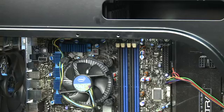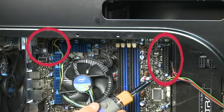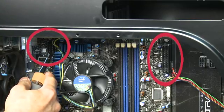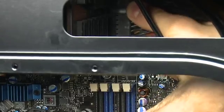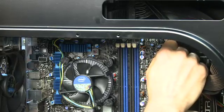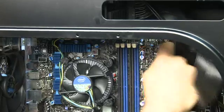On the motherboard you'll typically see two power connectors: the larger one generally away from the CPU, and then another one a lot closer to the CPU that's a bit shorter. You'll want to connect both of these to the power supply. Connectors will typically be keyed so that they can only go in one direction — push them until they snap into place.